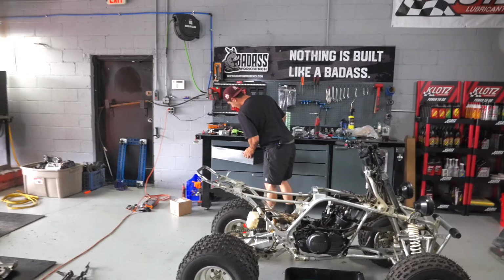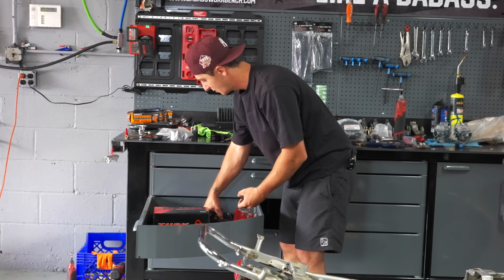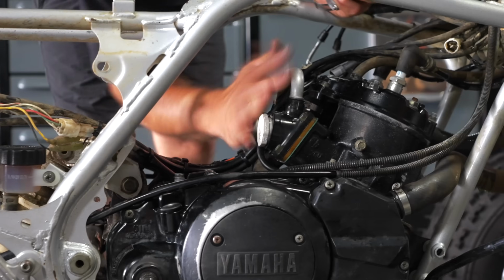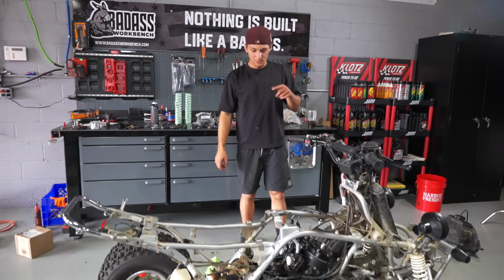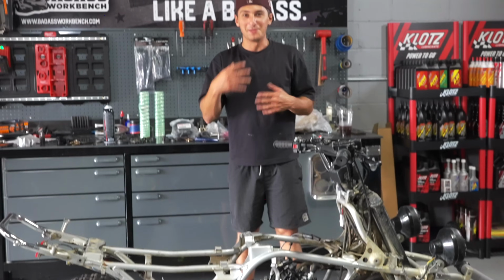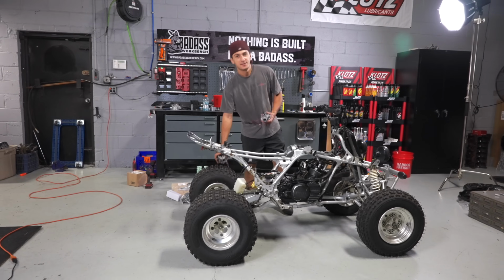So if you have a leak down test kit, this is the best way to wash your bike, like thoroughly. I'm gonna take 2 plugs for the exhaust ports and the intake ports. And normally I'll just take the OEM clamps off and use pipe fitting clamps. Not only do I have to clean the Banshee, but I gotta clean the shop. So once we have this thing clean is when we're gonna start piecing it back together, which will be in roughly about 2 seconds.